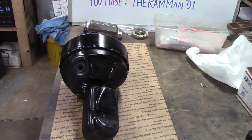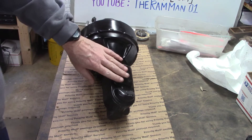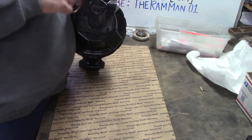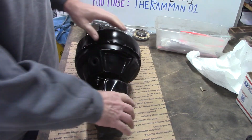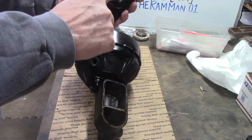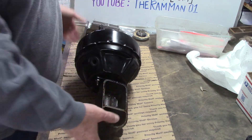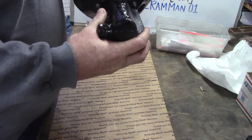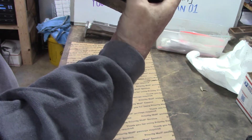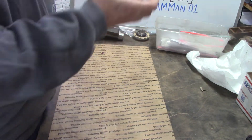From front to back, we have our 222-9191 Master Cylinder. It has that flush front on there. It's an inch and an eighth bore, and has the original Master Cylinder lid. Use J1703 — all that meant was use DOT 3 brake fluid. The casting number is there on the bottom; paint's coming off. 2-2-2-9191 for the Hemi. There's the piston retainer bolt.